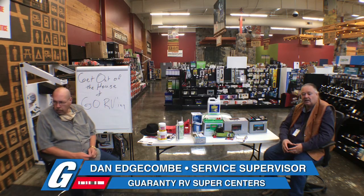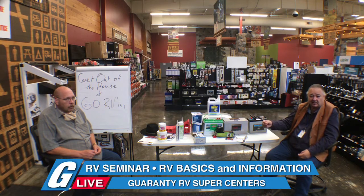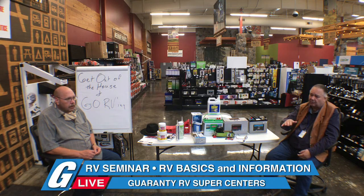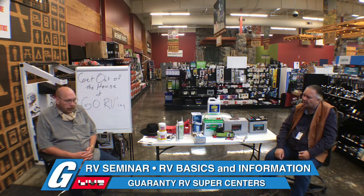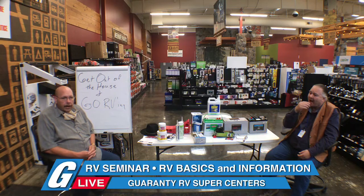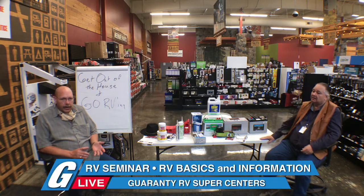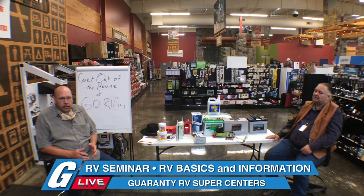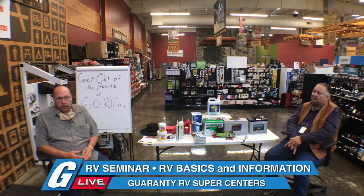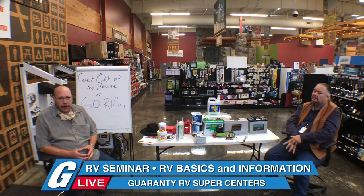What is the battery disconnect? In a gas motor, there is very rarely a chassis battery disconnect. But all motorhomes and a lot of trailers have house-side battery disconnects. They're basically used for storage. They were invented years ago so that when you're fueling, you can turn your batteries off so you have no sparks possible from refrigerators, water heaters lighting. It basically disconnects the complete motorhome so you're safe when fueling or filling propane. They also slow the amount of discharge on the battery when storing.